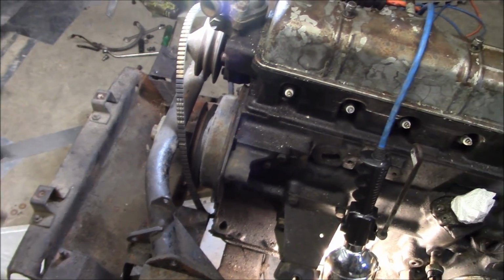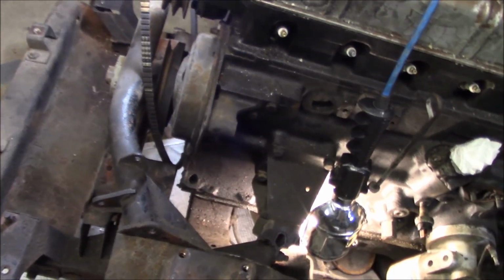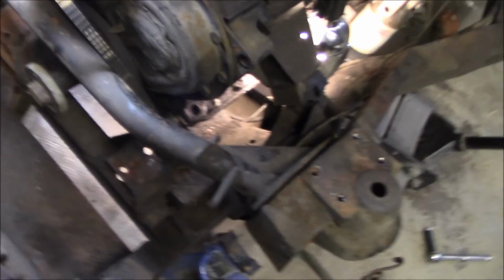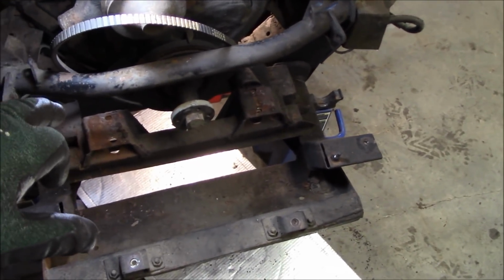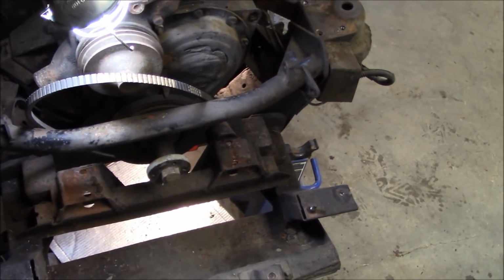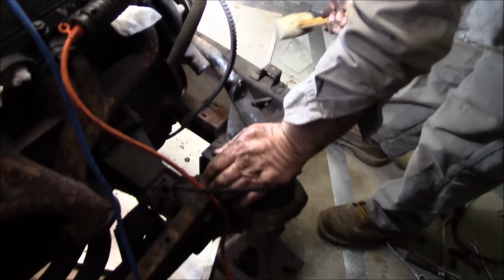Just saying to Les that it can be difficult to get the chassis cross tube out sometimes because there's quite a bit of friction in there. You can either get a rubber mallet and pound that out, or you can jack up the frame from the very center of the car, and that'll actually spread it out a little bit and you can remove it. But Les likes hammers, so he's got his rubber mallet here. He's just going to go ahead and remove that out of here. Carefully.